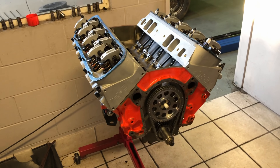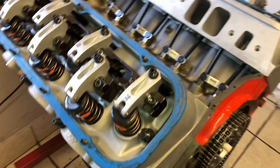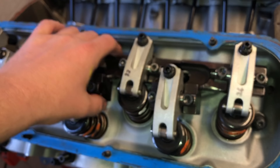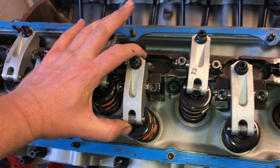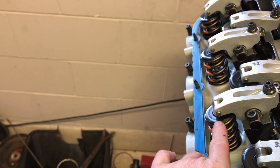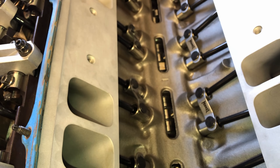There's our big block Chevy in all its glory this week. I've been staying back after work a couple of nights and most nights — the push rods are in there now. We set up the geometry on all those rockers. To get that geometry right, we had to shim them up and down, and once we got them happy, we tack the two together so they can't move and the rocker can't move on top of the valve. We centered the roller over the valve so at full lift the roller is in the center of the valve. The pushrods were sent down in a bag from the good fellas at Performance Wholesale.